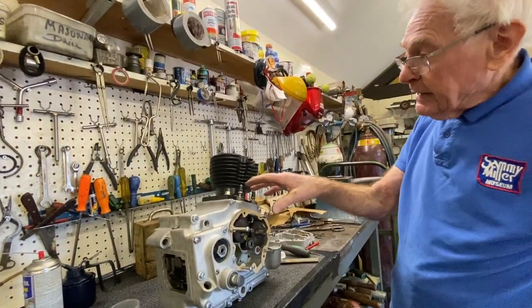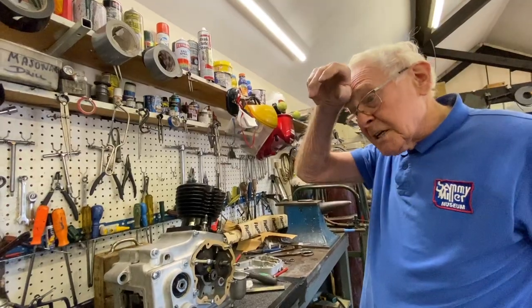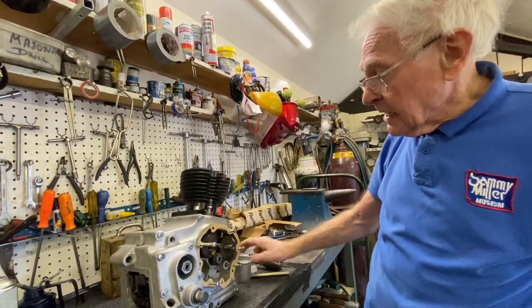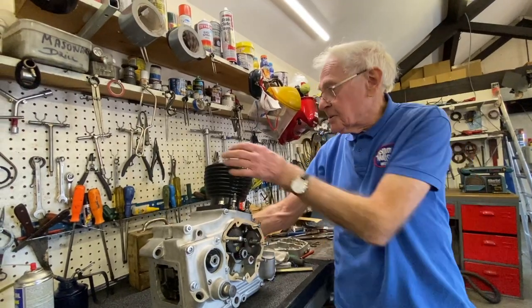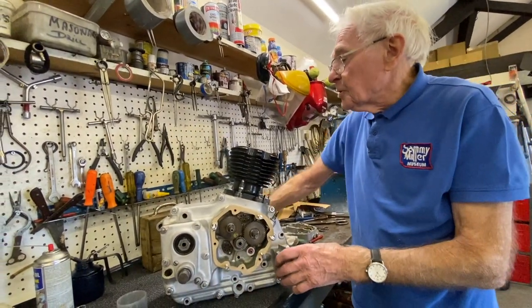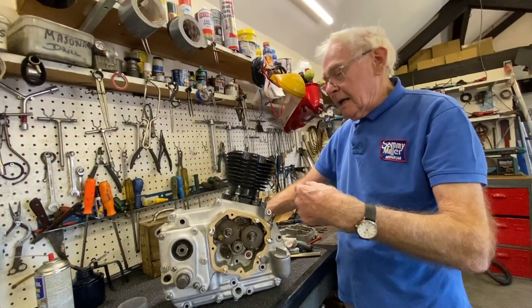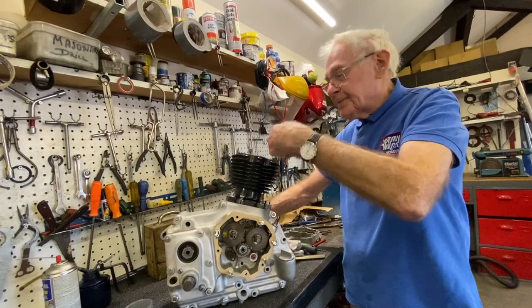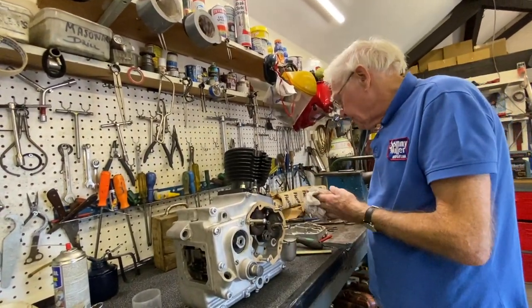But as I say, basically on the rock, 3/8 before top dead center, and you should get an engine that works pretty good. And don't forget, like Miller when he was a kid, trying to time the thing top before top dead center when the thing was running backwards, so he had to actually time the piston coming up as the engine runs backwards. That can fool a lot of people.